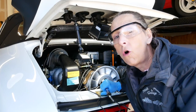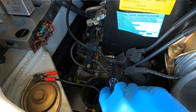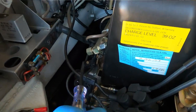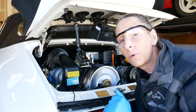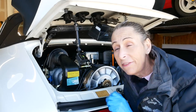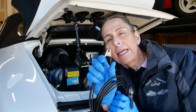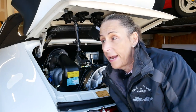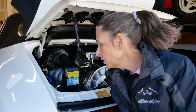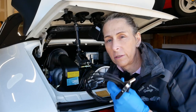With the coil wire swapped out for the old one, let's go ahead and do our zap test again and make sure we don't have any more problems. Our new coil wire is working great. The reason why it's so important to test before hooking up your scope is we're going to be connecting a clamp right over the spark plug wire. If there's a short and it zaps this thing, it will blow up your scope — we're talking 20,000 volts. Our scope can only handle 20 volts, so it really is imperative to do that zap test on all your spark plug wires before you start.